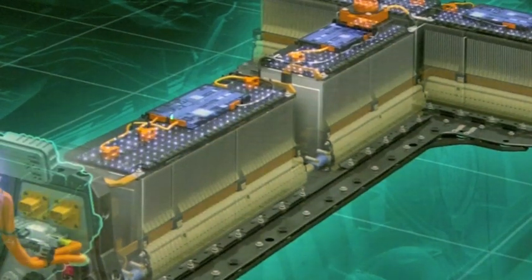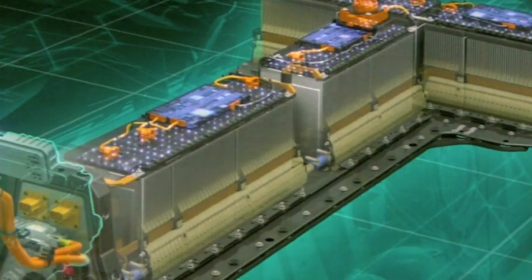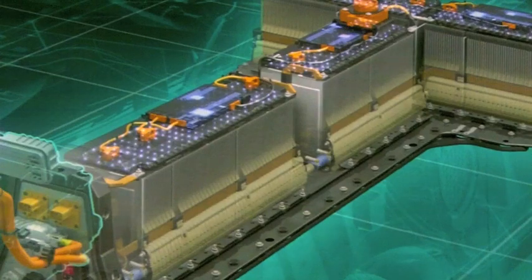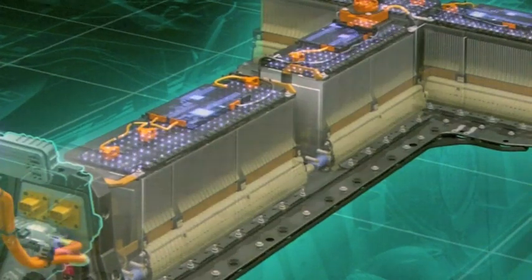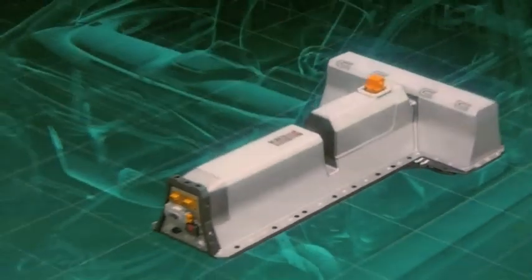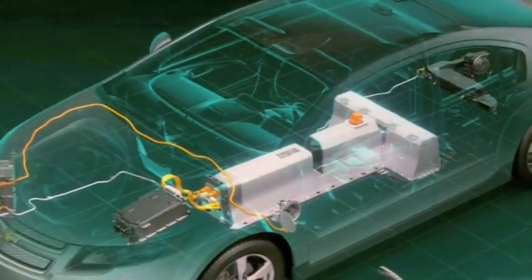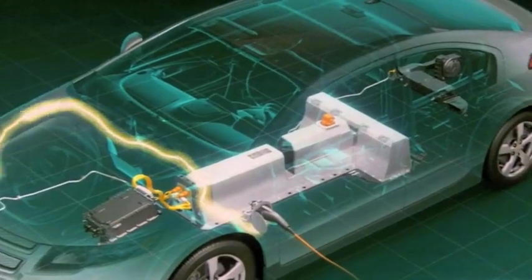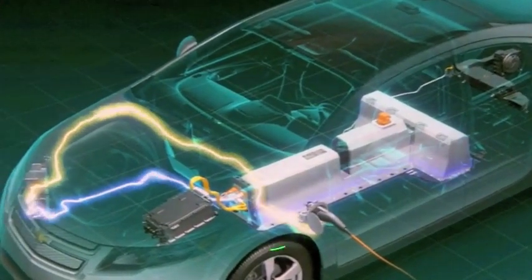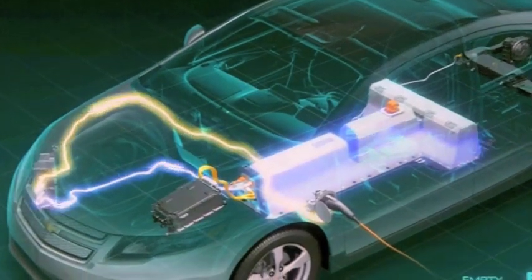Electronics are primarily in there for sensing voltage, current, and temperature, but they also have another important function: cell balancing. To get optimal performance out of the battery at all times, we have to make sure every cell is at the same state of charge, and those devices perform that function. The enclosure is insulated and also keeps out dust and water. During the charging process, we charge from the wall — again 120 to 240 volts — and it charges the battery to full.